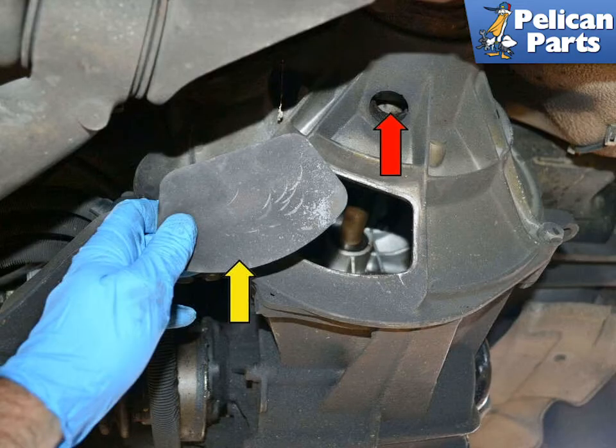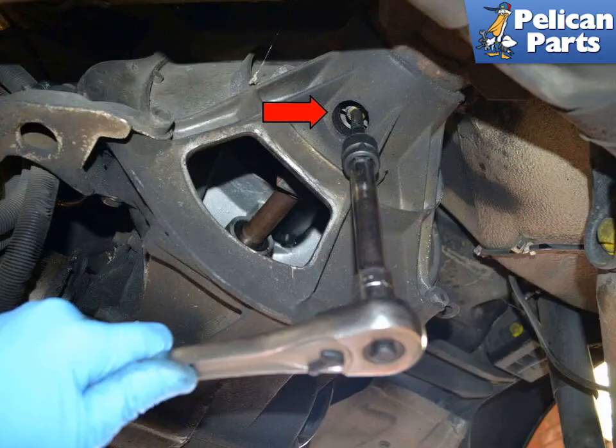There are two access covers for the torque tube bell housing — both of these should have covers on them. Use a flat head screwdriver and pop the rubber covers off. Rotate the torque shaft until you get access to the 8mm allen bolt on the front of the coupler. You need to completely remove the bolt as it sits in a groove in the spline. You will not be able to slide the coupler off the shaft with the bolt in place.